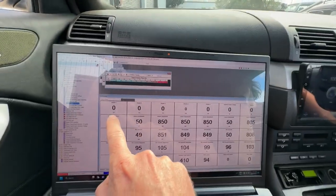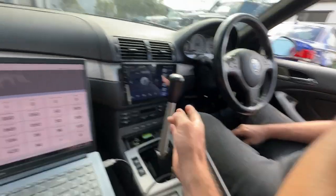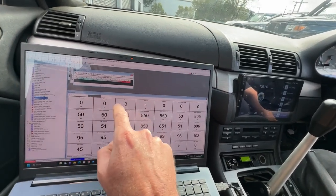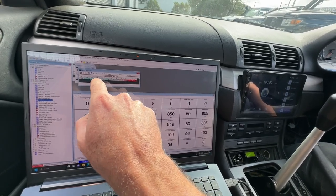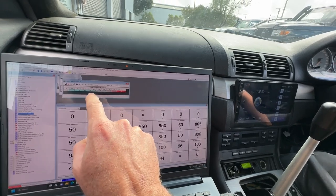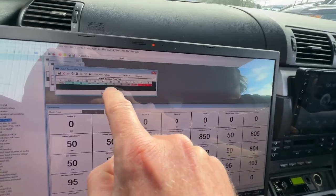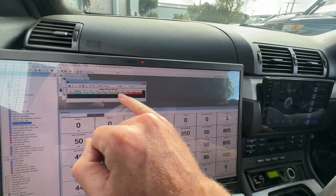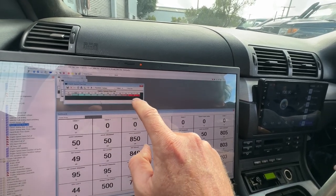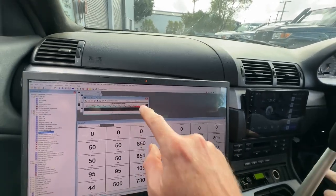The point of this is you want to find out where the car starts to move, when you first start to let your foot off the clutch, when you get your first bite point, and then you use that value. For us, it was 60. At around the 60% mark, that's where you start it, and then you taper it off, and that'll give you the feeling of the bite point. All of the work is happening from the 60 percent onwards. That's the way that we find these things work the best. And again, make sure you bring in the full clutch pressure earlier in this calibration, so that when you're at the 10% mark, you've still got full clutch engagement. I hope that makes sense.